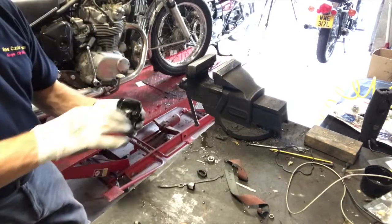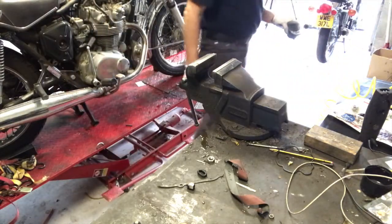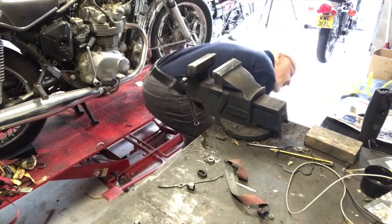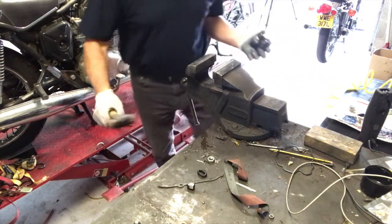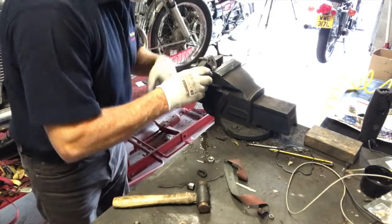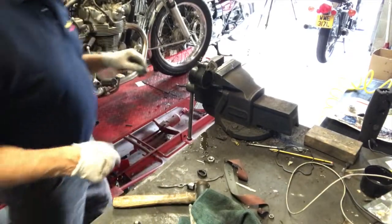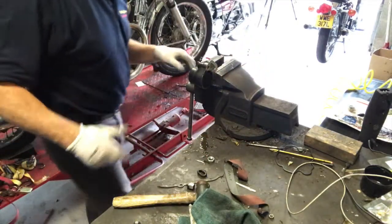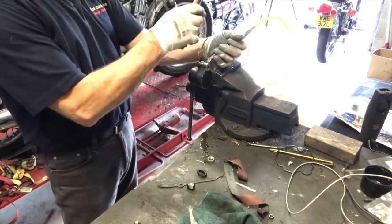So now I'm going to try. Now, I know that it's gone in, it might come out a bit with the compressed air. Let me switch this back on. I've got that caliper nipped in a position where it won't stop the piston from moving, because now I'm going to try the compressed air, and I'm also going to try a little bit of shock on it while I'm doing it, and that might just, this is a hide face hammer.